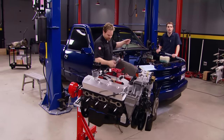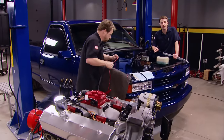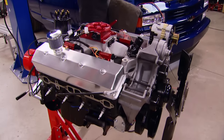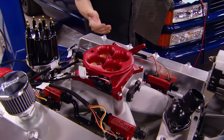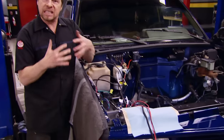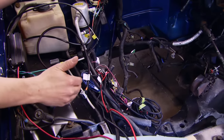Welcome to Truck Tech. Today we've got our 93 Chevy 1500 back in the shop out of our low buck sport truck. We're doing a little bit of work in the engine bay, cleaning things up and making it ready for the installation of our newly assembled and mildly built 383 engine. It started out as a stroker short block that we added a decent pair of cylinder heads to along with a performance camshaft. Another upgrade we decided to throw on was the FAST multi-port EFI top end kit. We also opted for the FAST performance coil and ignition box. The FAST ECU is on the firewall with the wiring harness running through, making everything work together with one big happy family of components. The plugs are all multi-pin professional OE-looking plugs, and this is a relatively simple bolt-on performance upgrade.